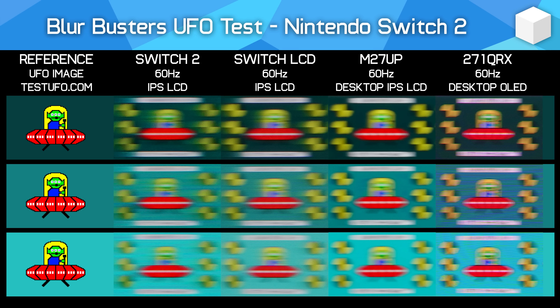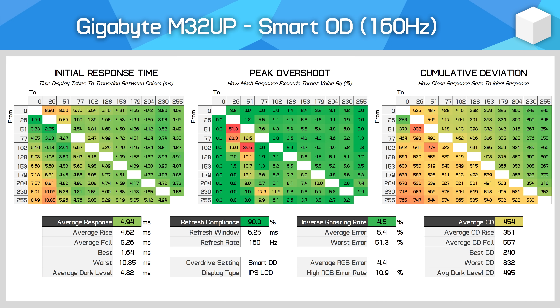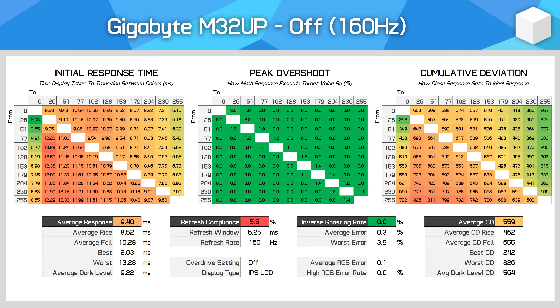That's the difference a 5-times faster LCD can create at 60Hz. So why is the Switch 2 LCD so slow? Nintendo are not using any form of overdrive on this panel. Overdrive is essential for fast response times on modern IPS LCD gaming monitors, and when you turn it off response times are typically much worse. My best guess is that Nintendo haven't implemented overdrive to conserve power — overdrive applies a higher voltage to the LCD layer to force it to transition faster, and higher voltage equals higher power consumption, which is not ideal for a handheld with a tiny 19Wh battery. I also suspect the display uses especially conservative voltage tuning to further improve battery life.